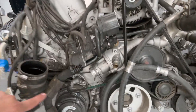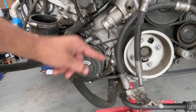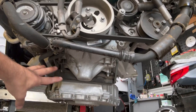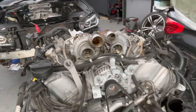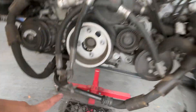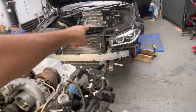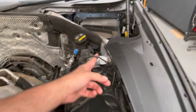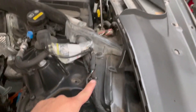and comes down to a small metal fitting right there. From this fitting you have a T-piece, and this T goes underneath to the reservoir. That plastic reservoir is your vacuum reservoir — it sits under the intake manifold of the engine. That's for the TU engines; on the first S63 engines you have two reservoirs on top. From the reservoir, one small hose runs up this side and connects to the struts over there on the left-hand side — it comes to this nipple right here.